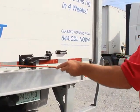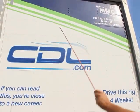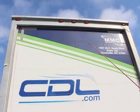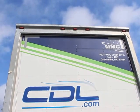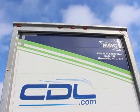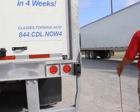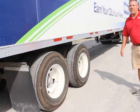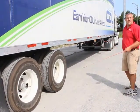My DOT reflective tape on my door is properly mounted, secure. At the bottom and the top, it's clean and in place. My clearance ID lights are properly mounted, secure. They're not hazed, cracked, or broken, and they're red in color. That's it for the rear. Remember, the right side, as long as there's not anything different on the right side than the left side, you don't have to mention it.